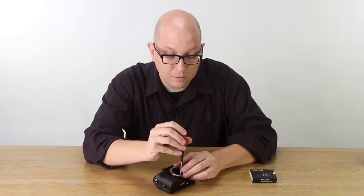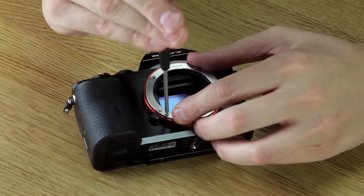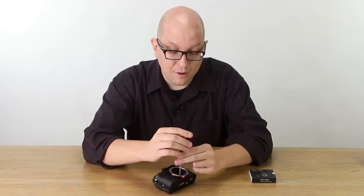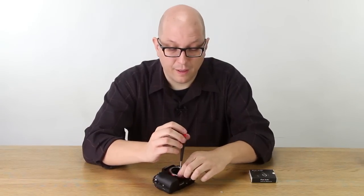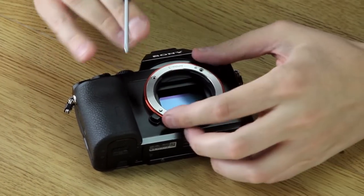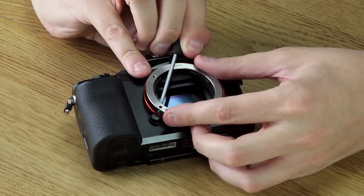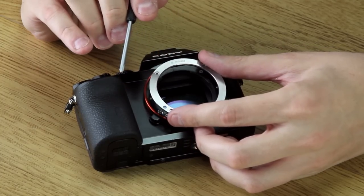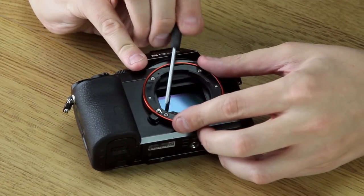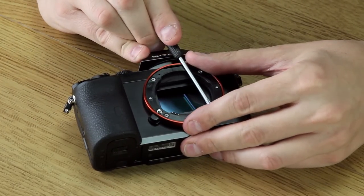And now the last screw. I'm loosening the last screw. Now keep in mind that there are some leaf springs here and of course that little button that we talked about earlier — they're not going to leap out at you or anything like that. Just be careful when you do this removal that you keep that little button right there in place. There's like double-sided tape that holds it all together, so you might have to work it a little bit to get it out. And again, be very careful — you're dealing with your camera's open sensor right here.